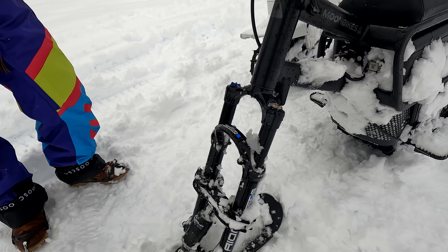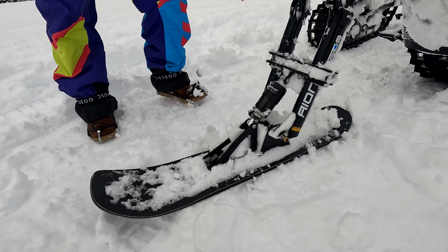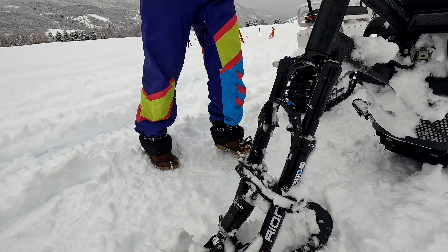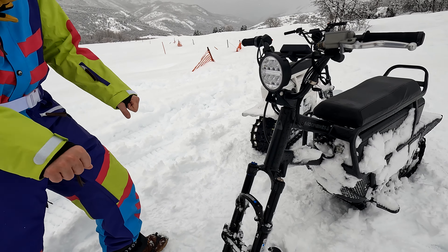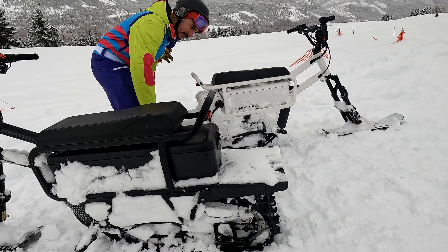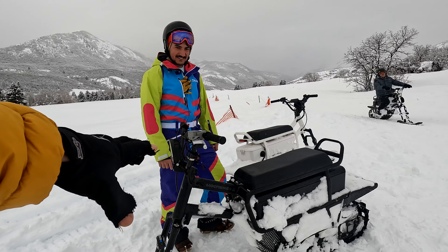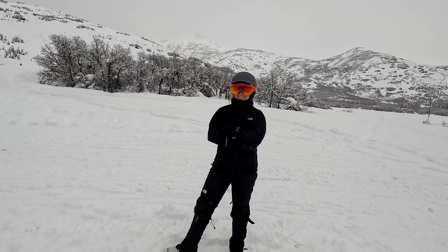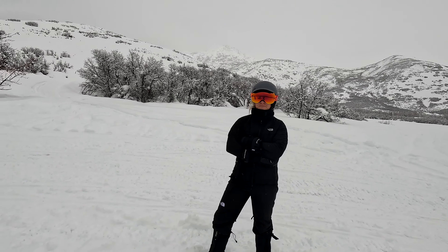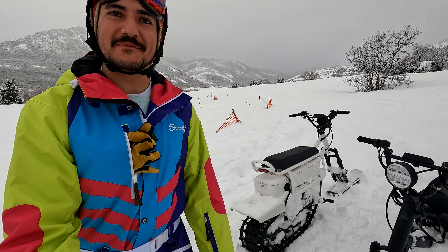There's a super bright LED on the front — hard to tell in flat light, but at night it's super bright and illuminates everything in front of you. The front fork is a modified mountain bike fork specifically tailored to the Moon Bike — simple but super reliable, something that already works. The ski is made in Austria — a powder ski specifically designed for the Moon Bike, with a carbide runner on the bottom that protects the ski and keeps it straight on harder terrain. There's about four inches of front suspension and two coils in the track giving another two and a half to three inches in the rear. The weight is manageable too — even my small girlfriend tipped it a few times and was able to lift it back up herself out in the deep powder.